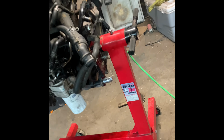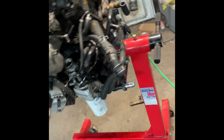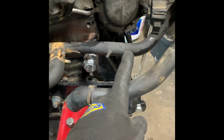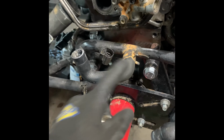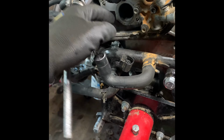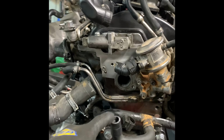Right now what I'm doing is putting the hard line for the manual transmission ones, because the automatic transmission ones only come with one nipple right here, and it has a turn down right here for the automatic where it cools off. Also, the manual ones have this nipple, which goes up into the little housing right here where the temperature sensor sits. It has this, which the automatic one does not.